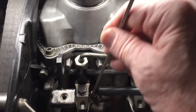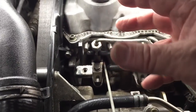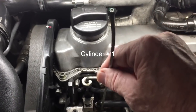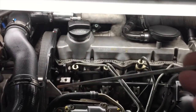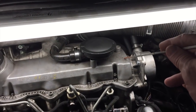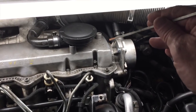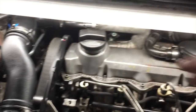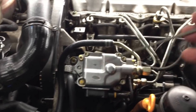I dropped the rod down through the hole once I brought the engine to what was theoretically top dead center. On a diesel, that rod can get caught and bent, so bring the piston up to where you think TDC is, put the rod in, then I took a wrench onto the fuel pump — it's right here, geared right to the crankshaft — and rocked it back and forth just a little, watching the rod go up and down until it hit mechanical top dead center. I also took this off and used the camshaft lock to dial in the camshaft. The fuel pump was way off from where it should be.